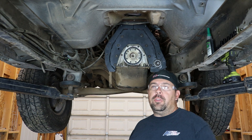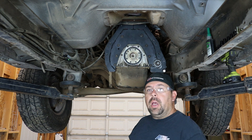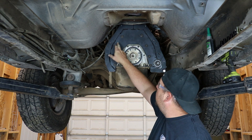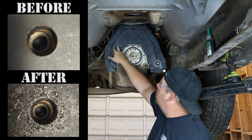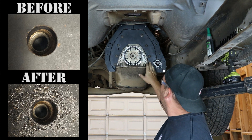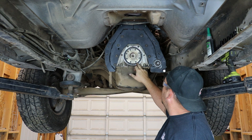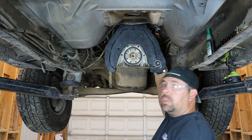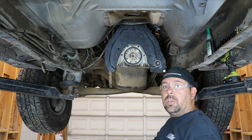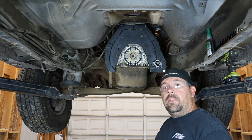So we're back — it's a few days later. I had to wait for a rear main seal and some other parts. But I've modified the plate; I had to bore this hole out a little bit to get it to fit. While I was off camera I torqued all these down with thread locker, replaced the rear main seal, and then I just stuck the starter in there so I could see what I was gonna do for a downpipe. Now we're gonna install the flywheel, clutch, and flex plate.